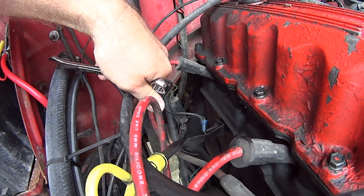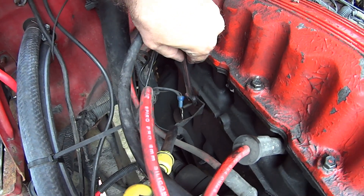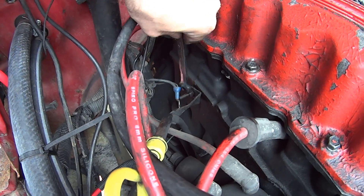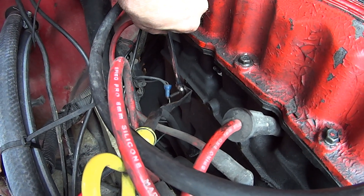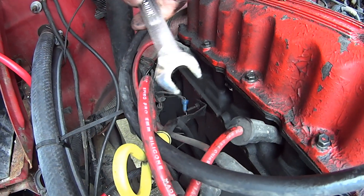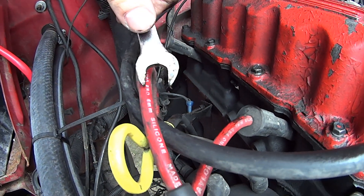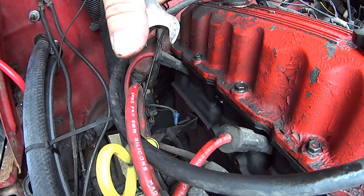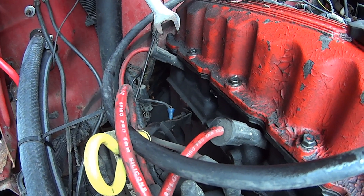I want to point something out - a little bit of a cumbersome pain. This stud right here actually goes back inside the block. Whenever I was trying to take the nut off from the outside - I'm using a 10mm here, and the back is a half inch or 13mm, those are interchangeable in some places - I had to take a wrench on the back side of this to hold it in place while I took off the 10mm, because this kept wanting to screw out of the block. Also, I've used the grinder to thin down this wrench so it fits back into tight spots like this - that works great for die grinders and getting back into areas like this.